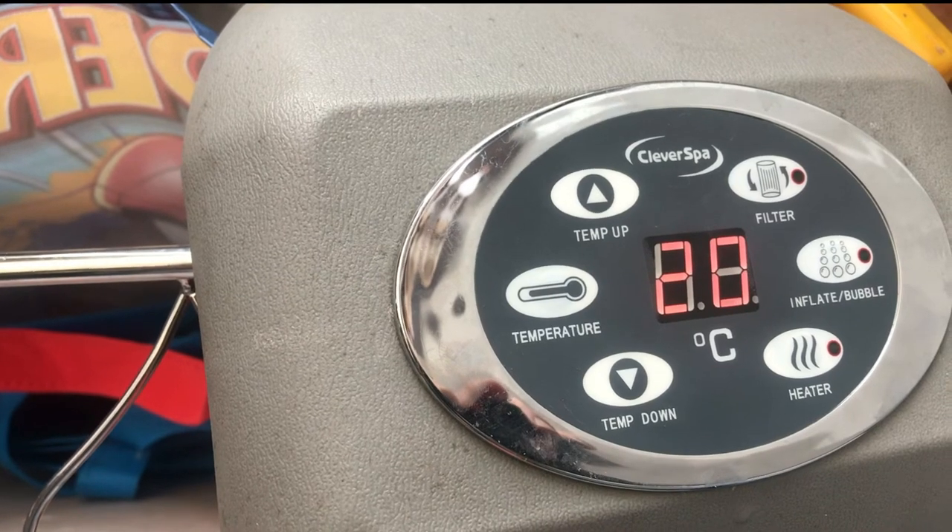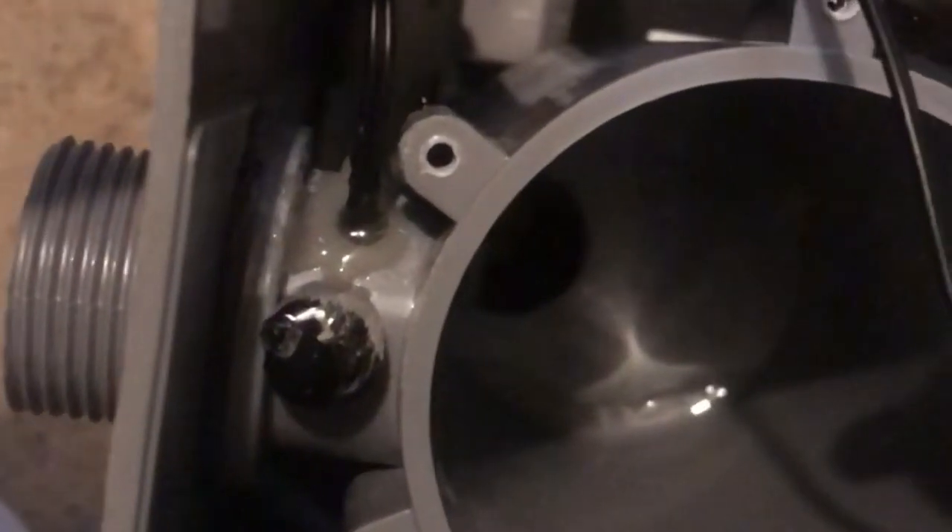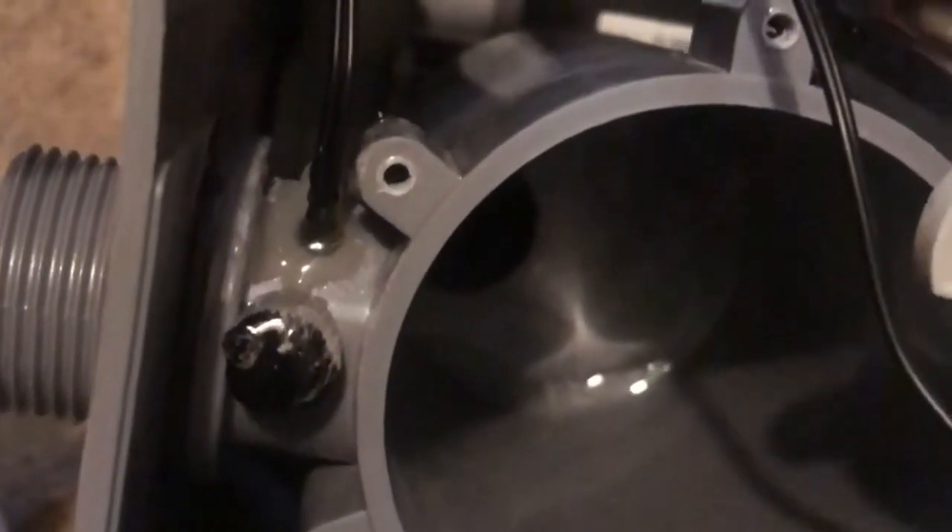All that's left to do is install the new sensor into the pipe. Use a drill the same diameter as the sensor — in this case that's 4mm — and drill a hole next to the original one. Once it slides in nicely, make sure it's not too tight so you don't scratch the surface. Use some rough sandpaper to rough up the pipe so the glue holds better. The glue I'm using is a two-part epoxy — Gorilla Glue — really strong stuff. Mix in equal parts and apply around the join. Put the probe in first, then put the epoxy around it, as it's thick enough that it shouldn't seep into the hole. I did this in about three goes, making sure it was completely set before applying the next coat.